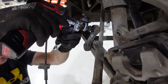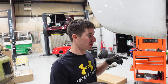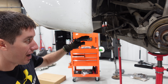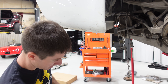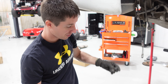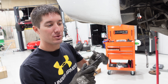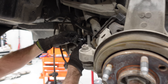It works — we got it off. We've got both sides of the car lifted up with screw jacks. We have to lift up the lower control arm so we can get everything into the right suspension geometry to change out the sway bar links. One of the fun parts is my torx bit just snapped off in the lower — it was so tight and had been on there for so long. So we're down one torx bit, but the new ones are hex instead of torx, which is cool. We should be ready to swap this thing in.